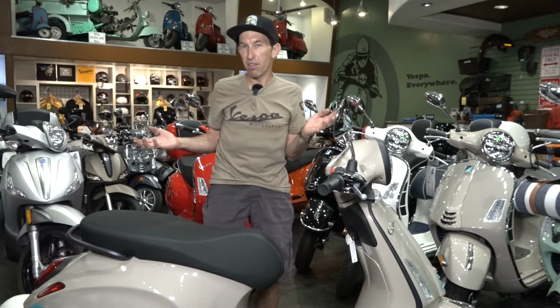Another noise is brake squeak. It's pretty hard to get away from it. You've got to clean the dust out of the brakes. Sometimes that eliminates the noise, or there are sometimes parts of the brake components that wear out that will cause that squeal noise.